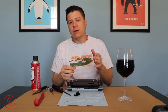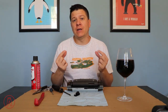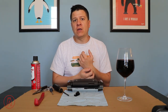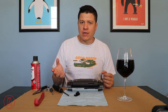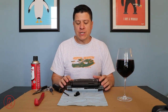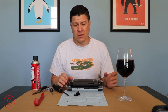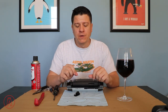Once you've done that, you can lift it up a bit and disconnect the start button. If you have a sport shift, there is also a connector on each of those buttons as well. You don't have to worry about the vents — those only have a bit of foam padding that is there for insulation. Don't be surprised if that foam is falling off; all you need is a little bit of glue to put it back on. That's very common — I see it on almost all cars I've ever done this on.